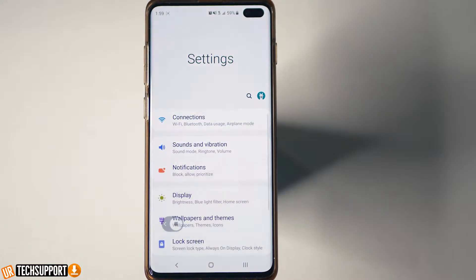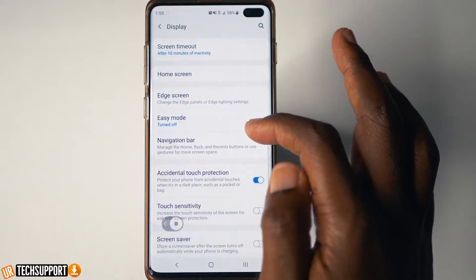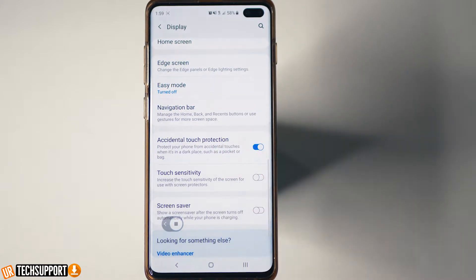Let's troubleshoot some accidental touches. One of the first things you want to do is check the accidental touch setting itself. You want to make sure the accidental touch setting is enabled on your device — if it's not enabled, that could be why your device is powering on when it's not in your hand. Go to Settings, then Display, scroll down to Accidental Touch, and flip that switch on. Hopefully that will prevent the device from powering on unintentionally.